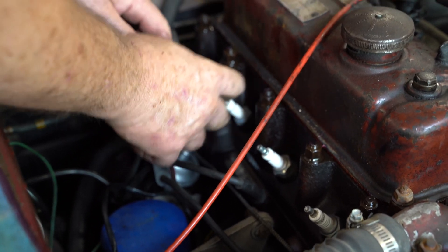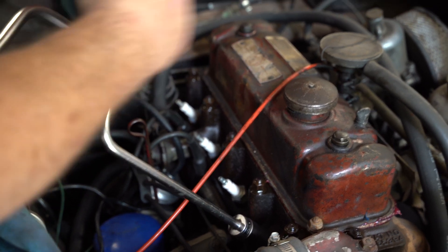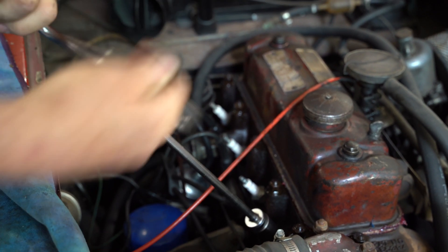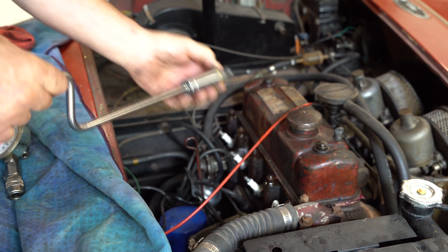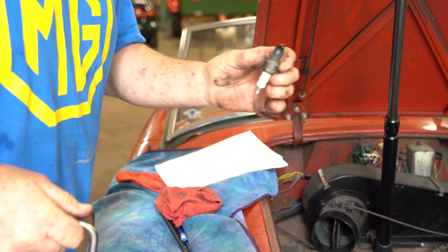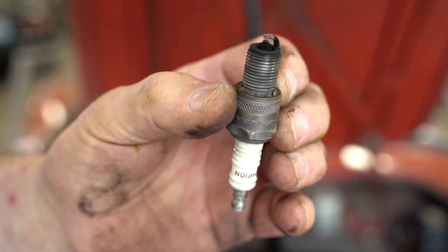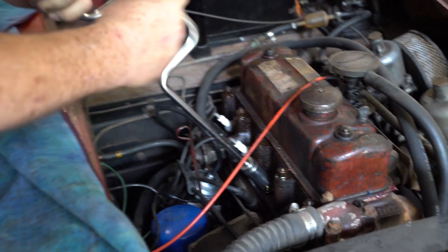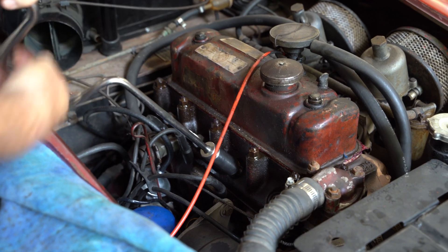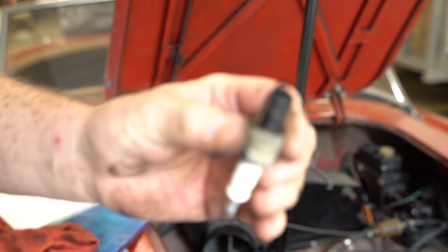Should you check the compression with the engine hot or cold? I prefer hot. This is cold, but we're going for it. This is a speed wrench — the greatest tool for taking out spark plugs because it's controllable, and all you have to do is hit it. We can look at the spark plugs when they come out. This one's all black, but we don't know if this car has been idling for half an hour before it was parked two years ago or not. It isn't until we go outside and take a 10-mile run at speed and then come back and read the plugs that we can decide if the carburetors are working well or not.